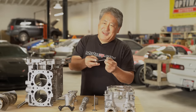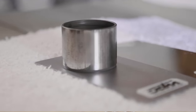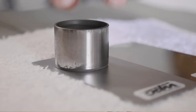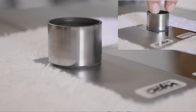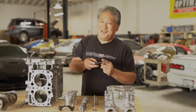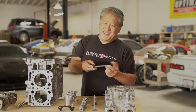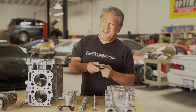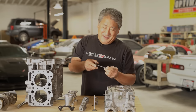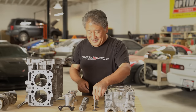For long life, our valves are cryogenically treated by CTP Cryogenics and we also WPC treated the valves, particularly the stems. WPC is a Japanese metal treatment process that gives a really hard, smooth, lubricious surface finish that wears really well. Even though the stem is nitrided, you can still WPC over nitriding and it still works. WPC also doesn't change any dimensions, so you don't have any problem with your valve-to-guide clearance after treatment.